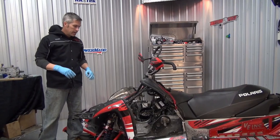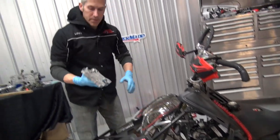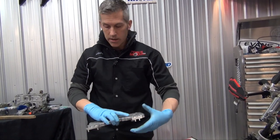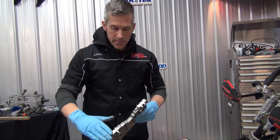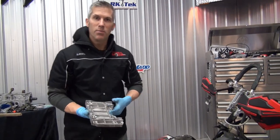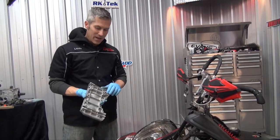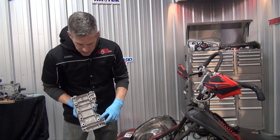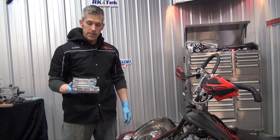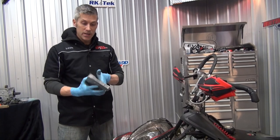I'm going to show you how everything fits. This is the base plate for the 800R motor — usually there are two bosses on either side and that's where your motor mounts are. So I shaved those off and machined the bottom of this flat. Good old JL, our head tech, machined the bottom of this. On the bottom of this motor there are these nice little places here for studs that aren't really utilized on this application, but we're going to use them.